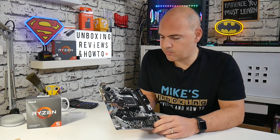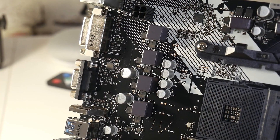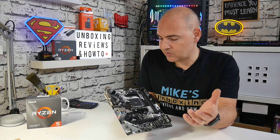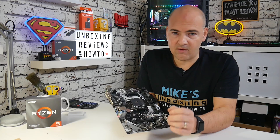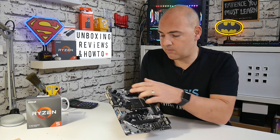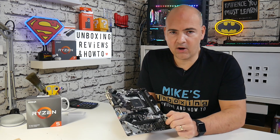There isn't a great deal on this board — there are no heatsinks on the VRM. This is a four-phase VRM; it's not a particularly good VRM, good for up to around 75 watts of input. So this certainly isn't an overclocking board. Overclocking is possible but it's not the best board for that, and due to the restriction of power delivery, it's not going to power some of the higher-end CPUs.